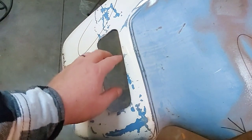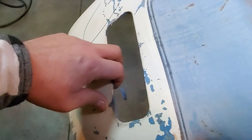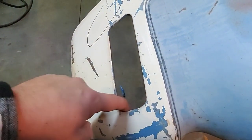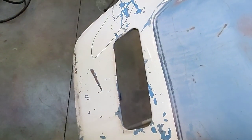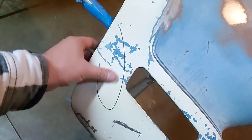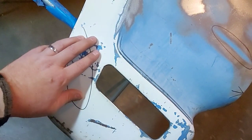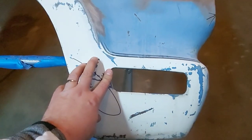The first thing I'm going to start on is shaving these marker lights to give it a cleaner look. I've already cut out the mounting flanges that went back here, but I left the rolled lip all the way around because that helps give the fender strength. I didn't want to cut that out all the way. So first I'll clean this out and hammer and dolly it so it doesn't affect the shape of our patch, and then we'll get to making that patch.